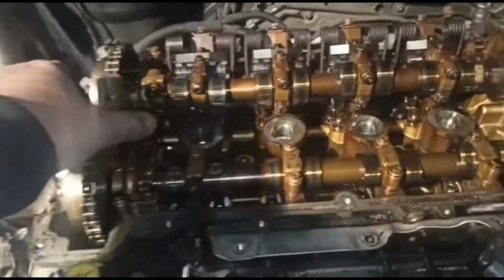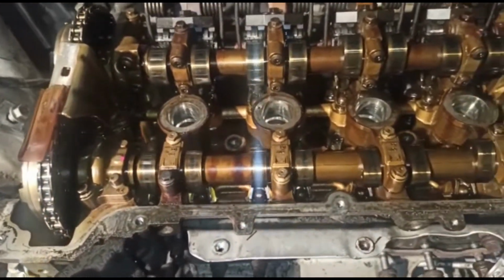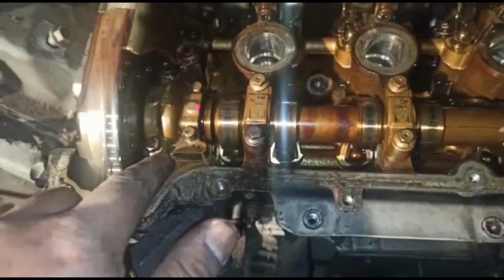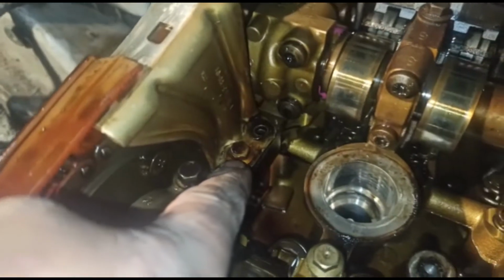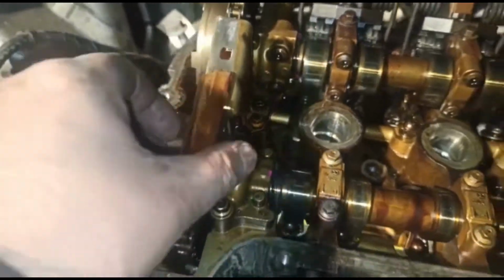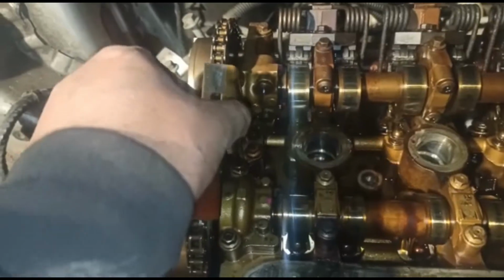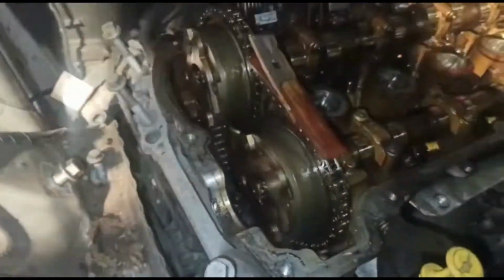I'm taking the cams out because the person I'm taking this head to wants them without the cams. So these 8mm bolts here on each, those will come off, and these two 8mm bolts here that I would loosen out. I've done one already, and you can see what's happened with mine. So this is part of this guider at the top, which is broken off, and that's kind of what the problem is in mine. And I'm not sure exactly what's happened with the rest of it.